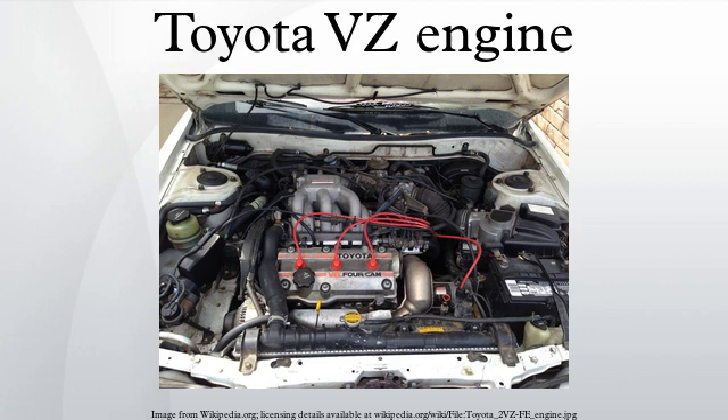3VZ-FE: The basic design is a revised 3VZ-E iron block engine mated with aluminum DOHC 24-valve heads. It has a forged steel crankshaft and cast connecting rods. The upper intake plenum is of the split-chamber design with Toyota's ACIS variable intake system feeding three sets of runners for both heads. Because the VZ was originally for pickup truck and SUV use, the 3VZ-FE happens to be a physically tall motor. To make the engine fit in FWD engine bays, Toyota tilted the motor towards the firewall. This tilt is so severe that reaching the rear bank of cylinders is nearly impossible without first removing the intake plenum. The 3VZ-FE shares very little with the rest of the VZ engine family; the main bearings are shared with the 3VZ-E, but little else.